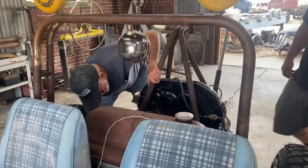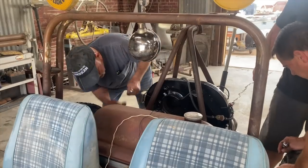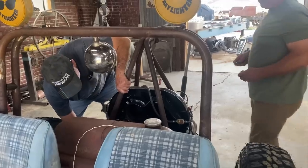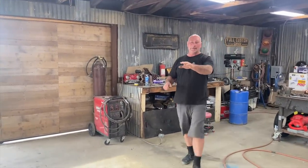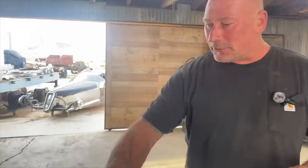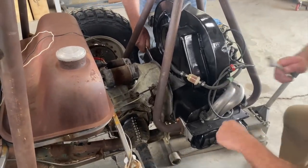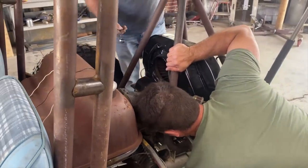You might want to get in there and round off your nut right here. Oh, you do it from the bottom with a regular wrench. Typically with a Volkswagen car like a Beetle or a Ghia, you have to access the lower engine bolts from the bottom because there's a bunch of cooling tin around. Swing that underneath and you don't even have to lay down — put it from under there and tighten it, no problem.